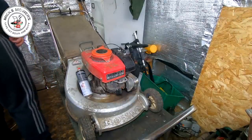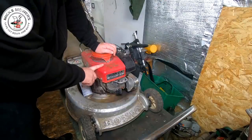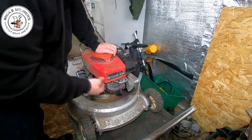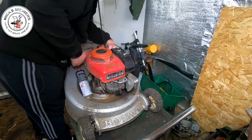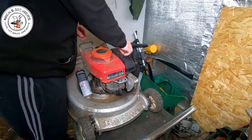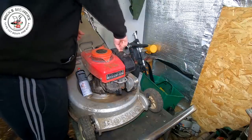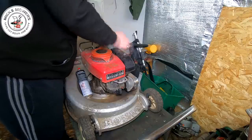The first thing I'm going to do is take off the airbox cover, the top cover, and possibly the carburetor itself to take all the housing off. It's one bolt here, one bolt here, a couple on this side — undo these two wing nuts and then we go from there. This machine has been coming to me for about three or four years and it's never been a problem, but she's quite an old girl and parts are readily available though I don't carry them in stock.